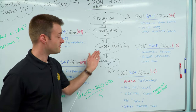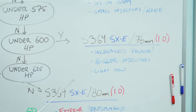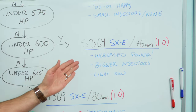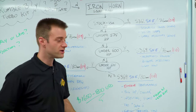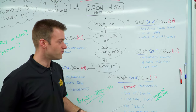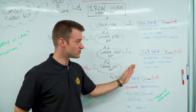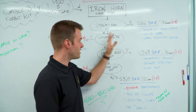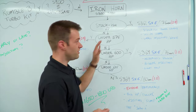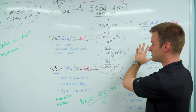So we're looking to make 600 horsepower — we're going to get you the S364 charger kit. It comes with increased power and you're going to need bigger injectors. You could use a bigger CP3 pump, but you don't necessarily need it here. This kit is for light towing; if you're doing more towing, I'd probably slide you back to the 363. This is the real meat and potatoes for the 5.9 Dodge. Early 5.9 — 361 to 363. Later 5.9, like 05-plus — that's where the 363 to 364 is right. This is the meat.